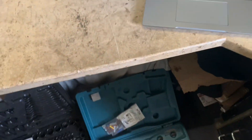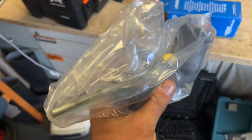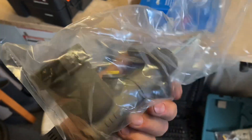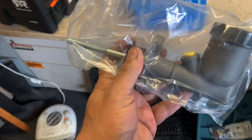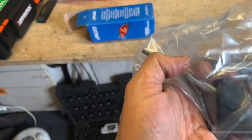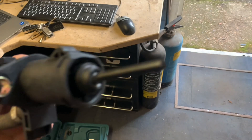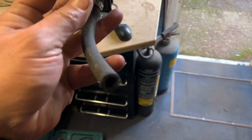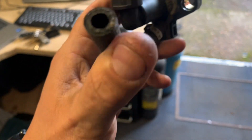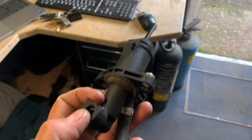Over here I've got one of these — a Peugeot clutch master from Euro Car Parts. Looks like it's going to do the job. I'll need to run an extension onto this point here with an adjuster on it, so yes, you can adjust it in and out. It'll have its own reservoir, whereas the original setup would have run off the brake master cylinder. Unfortunately I did snap this end off when pulling it out of the car. I didn't want to go that route — I wanted an individual cylinder with its own fluid.